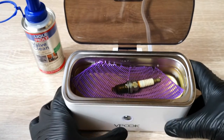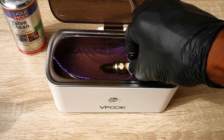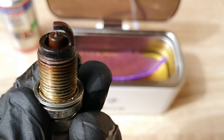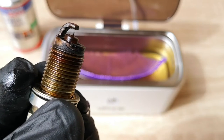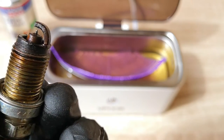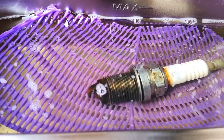I first started by using Valve Clean from Liqui Moly, which has built a reputation for dissolving carbon. However, after three rounds of five-minute cleaning cycles, it became quite clear that nothing was happening — the product had failed woefully. In all fairness, the manufacturer never recommended it for use with an ultrasonic cleaner. Also, the fact that it was causing large bubbles wasn't a good sign either.